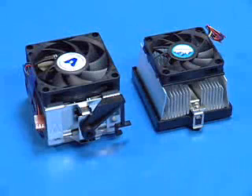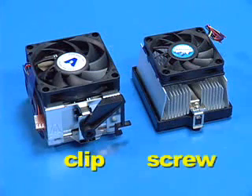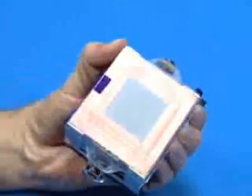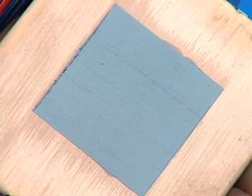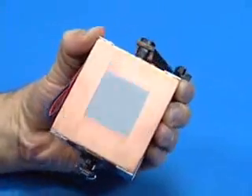There are multiple configurations of heatsinks being used for AMD processors. The two most common configurations are the clip heatsink and the screw type heatsink. Both heatsinks have a thermal interface material pre-applied on the bottom, protected by a clear plastic cover. Visually inspect the thermal interface material and carefully remove the plastic cover. Do not use the heatsink if the thermal material has scratches or gaps.